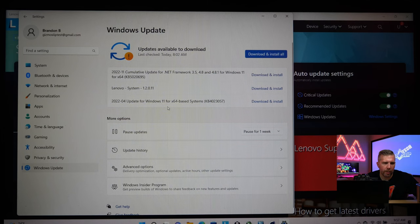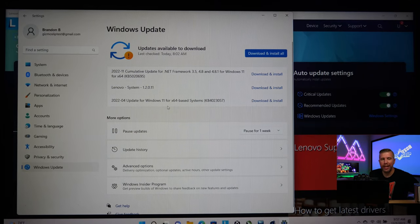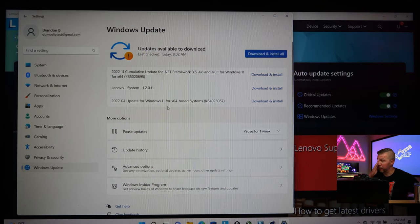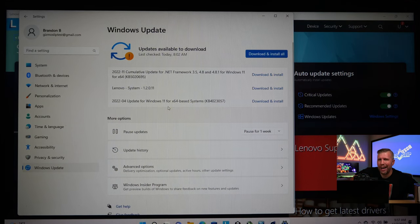Okay. I typically change the graphics settings in the NVIDIA control panel. You may also be able to do that there. I'm not sure which way is best. Windows 11 added that option to switch which application is used to launch, inside of the Windows graphics switching settings. So far that's worked for me every time I've needed to change things, but if it doesn't work for you, maybe you need to do it in the NVIDIA control panel. Depends.